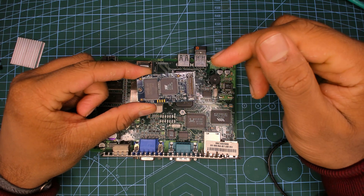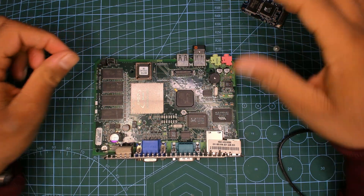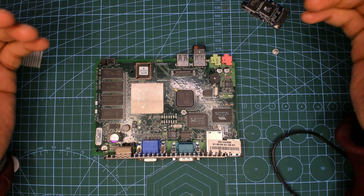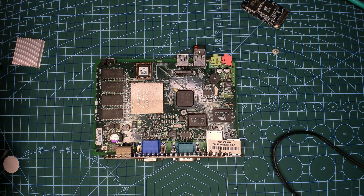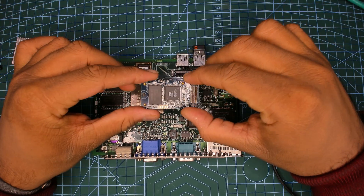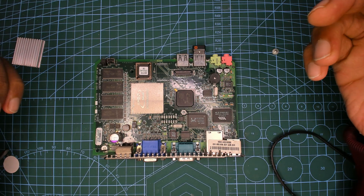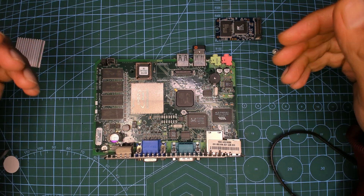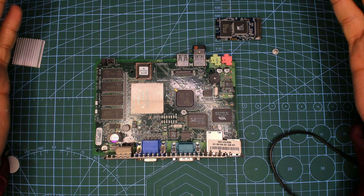It's a NAND flash to IDE controller and that's the IDE port it connects to. There's absolutely no way to install anything meaningful apart from DOS on this. It came preloaded with Windows CE from around that era. I couldn't extract the data from it because I had issues booting Linux and other things, but I did capture a video of Windows 98 SE running on it, so I'll run that clip quickly.